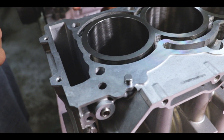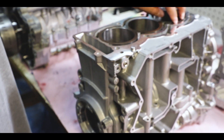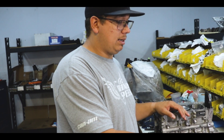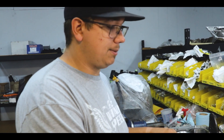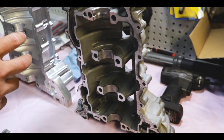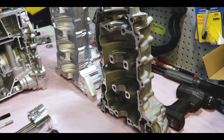Darton does the 11 millimeter head stud conversion for us in the CNC. This is basically a WSRD custom sleeve — it was not available from anybody else. Anyone getting them at the time was using a blank and cutting it down to size. This is basically what we ran all of last year — running an XR54 at 55 pounds of boost. The car was making really good power but we started noticing issues with other parts of the block, particularly in the bottom of the engine: bearings wanting to rotate in the main housing bore and studs loosening up or pulling out threads.